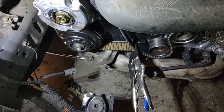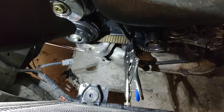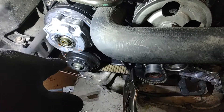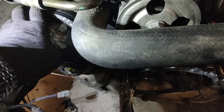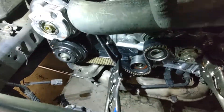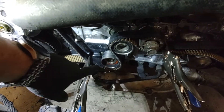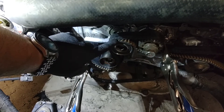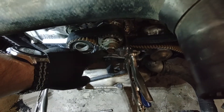I found another YouTube video and I thought I would share this. This is going to cost you a belt if you didn't plan on replacing a belt. Take a timing belt for this engine. On the passenger side, you can do it one cam at a time. But there's not enough clearance between the two cams to get the belt in there, so you have to do them wrapped at the same time. Wrap the belt around both the cams — just wrapped like I was doing timing — then pull it tight up around the first idler pulley and then around the second idler pulley. Try your best to get these teeth to interlock. Wrap it one half on the top and one half on the bottom of the crank sprocket.